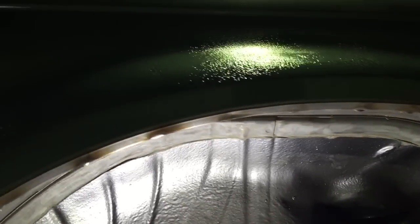That bit there isn't burning through — that's just where we're tackling some corrosion in that area ourselves. It's all around the arch. It doesn't matter if it burns, but we're going to see how well this does since the car has been painted. Well, the plug welds are done on the inside and there's hardly any paint damage — a little bit of distortion up in the corner. The heat shield gel has just treated where the heat was. The only slight mark I saw was around this plug weld here on this paintwork. All in all, it's a very good product.